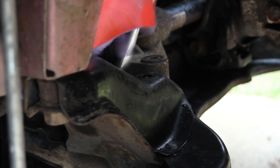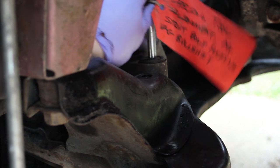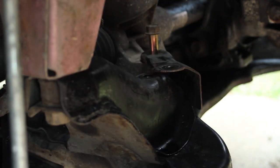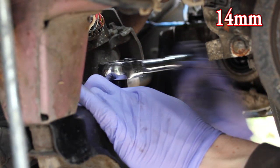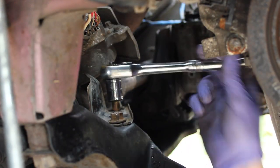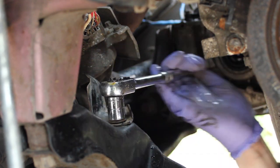We're going to put the power steering pump back on. Luckily I have this tool from working on the Audi previously and I just used it to line bolt holes up, basically just to make sure everything was where I wanted it to be. That lined up, I was able to put the bracket on and put these two bolts in nice and quickly, and that gets the power steering pump back into place. So we're going to quickly do that up.